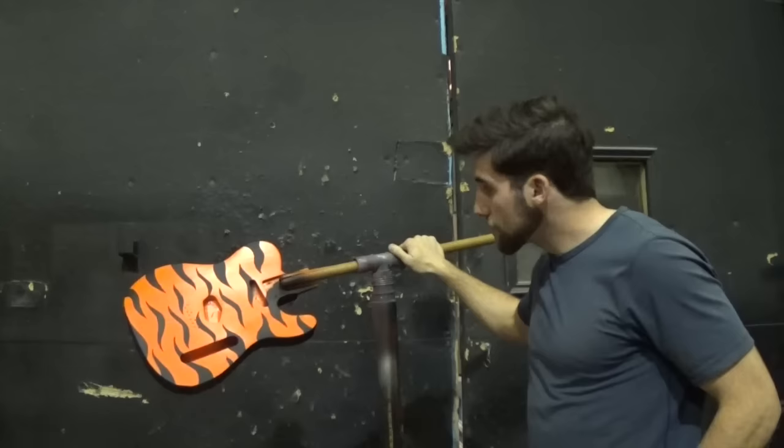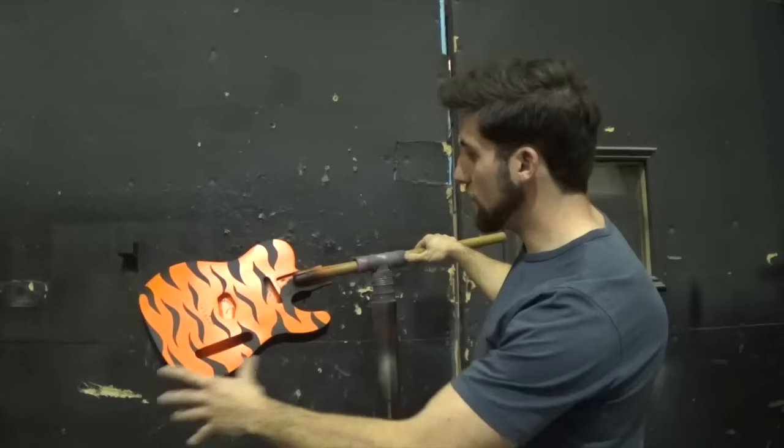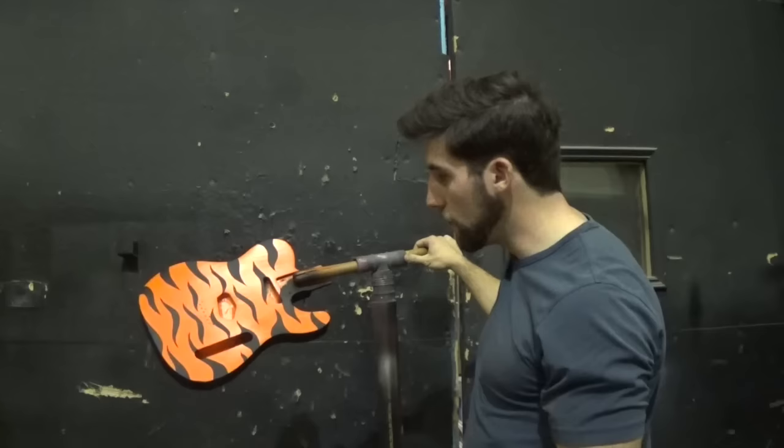So at this point, I'm going to let it dry. I'm going to let the black dry a little bit so that I can come in with my clear coat in a day or two. If you manage to get all that done within about 10 minutes of putting your second color in, then you can go ahead and spray right over it, because the orange in this case would have been scuffed, so the clear coat has something to bind to mechanically, and the black would have just flashed off, so the clear coat could bind to it chemically.